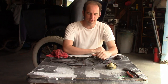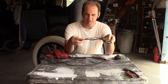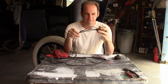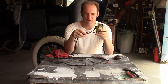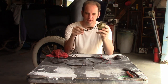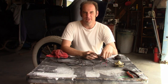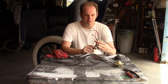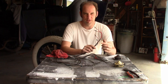As for the wiring, there are a few options. One way is to buy a new wiring harness, and you can get good quality reproduction ones in cloth insulated wire as they were originally — like what this one started out as, the one off the touring car. The problem with that is the commutator is downwind from the crankcase breather, so after about a month of driving, all four wires are black, and you can't wash the oil out of these. What some people do is just make their own wiring harness, which is what I did last time, but I was on a low budget so I made all four wires the same color. So I'm going to make a new one color-coded properly.